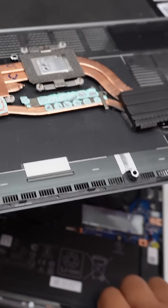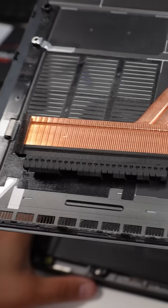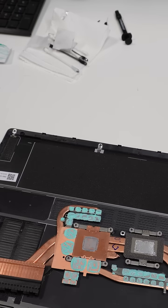Well, I'm kidding. It looked like one of those "if you squint" mint videos, because it's really hard to handle this stuff and to make the perfect application — you need surgeon-like hands and maybe robotic applicators, and I've got neither of those. That's what makes liquid metal a headache. You definitely have to have the right environment in order to apply it, and very small errors or mistakes can cost dearly.